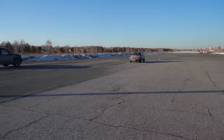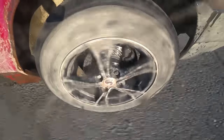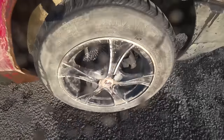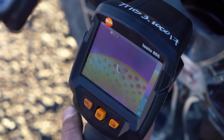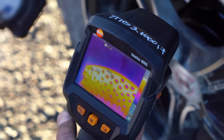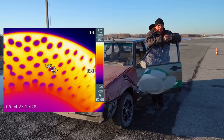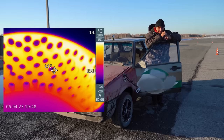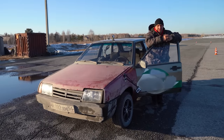Pedal is to the floor. My speed was slightly under 80 km/h — maybe 78 — when I began to decelerate. The temperature is 140 at the edge and 115 in the middle. That part is riddled with holes, but there is a small surface area left which the pads heat up to an enormous temperature.